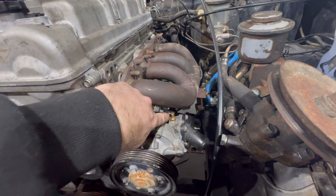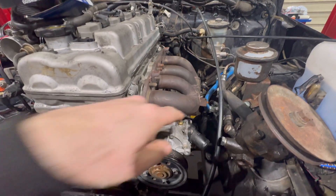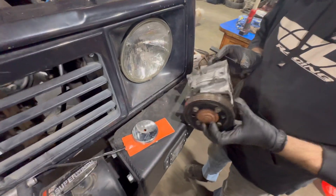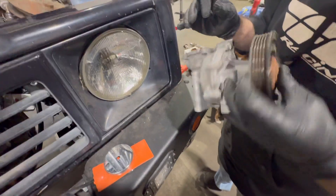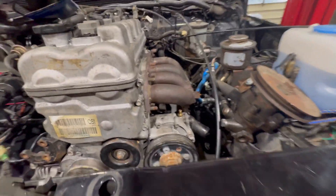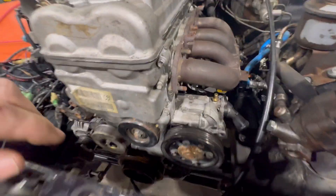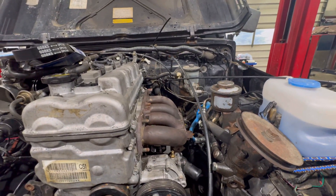I think what we're going to have to do is put a new fitting. I talked to John Brown and I think I'm going to drill and tap it on the other side — I've got a whole other water pump here, so we'll probably just drill and tap it on the bottom. We're going to go off the bottom and come through this hole right here and reroute it, because that rubber hose is going to get melted by this header.